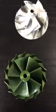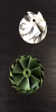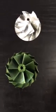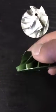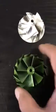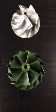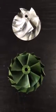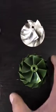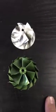Right, sizing on the inducer of the compressor wheel for the Golf 7 R. The inducer — we're starting to refer to that part of the wheel there — obviously the exducer is at the back. The specific wheel has got an extended tip, as you can see sticking out past the back of the exducer. It has seven blades as opposed to six blades on the standard wheel, so it's doing more work. It has a higher flow rating — you should get a 400 to 450 horsepower capacity out of this wheel. The inducer is almost 50 millimeters and the exducer is obviously quite a bit larger — we won't disclose the exact sizes.